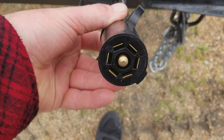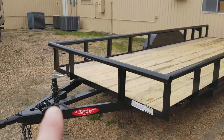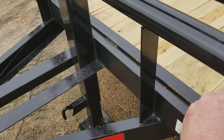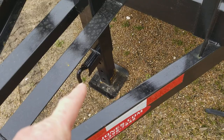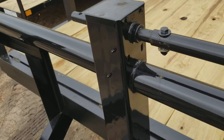You can put a spare tire there. On the smaller one you'll just have the one. This is how you control this one — from the side, and you can see where it is compared to the middle on the other. I've actually had a customer who jacked it all the way up without pulling this first. What that does is bring up your kickstand. He kept cranking, torqued it down, and broke everything on the inside. So beware — you've got to pull that and it'll drop it down or raise it up.